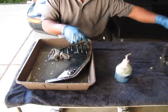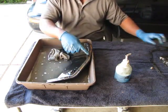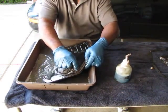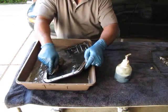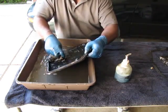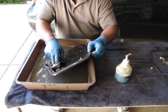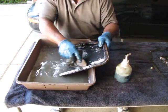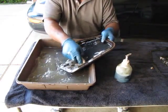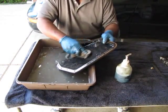And here, we have the new gasket. It's rubber. I actually think this cork gasket might be better. So I'm going to go ahead and leave it on. That's a call you'd have to make. If your gasket tears when it's coming off, then obviously you want to change it. But in this particular case, I'm going to leave the gasket on. It's going to save me work, and I think it's going to provide a better seal and more longevity. And it's served this vehicle well so far.